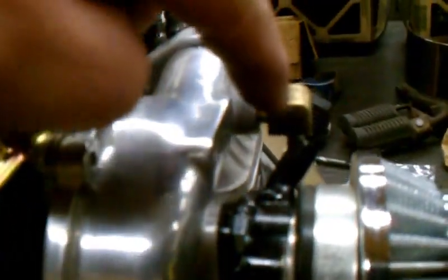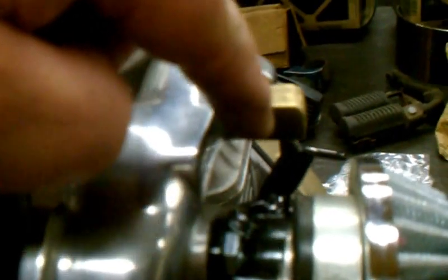You plug that with a nice little plug, and then you can either drill and tap right here or drill and tap right here to put in a brass hose barb or whatever, to the vacuum port in front of the turbo. And that's going to keep you from pushing against the PCV valve and possibly pressurizing the crankcase, which is really bad for your oil seals.